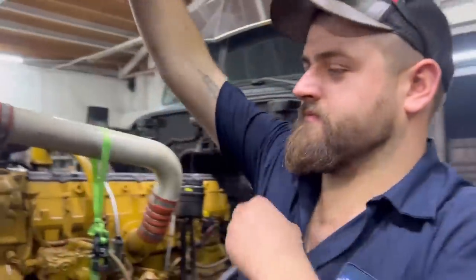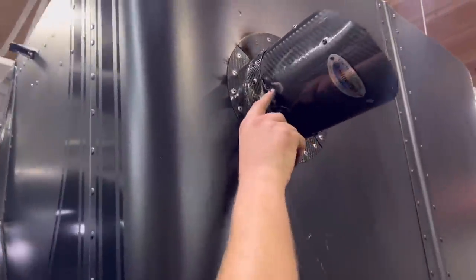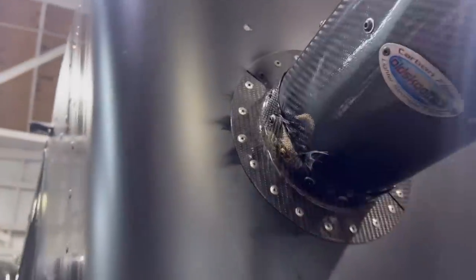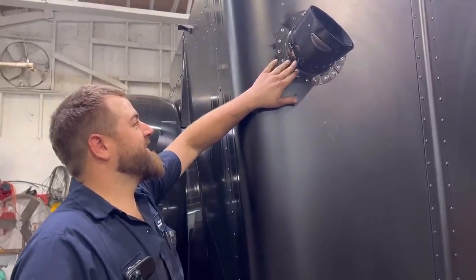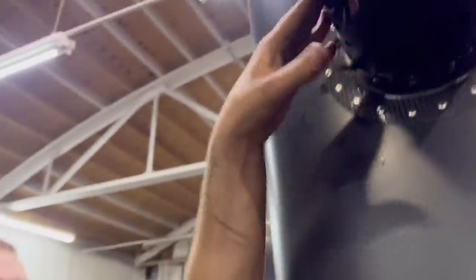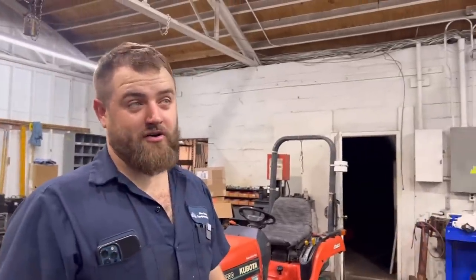Ryan is about to have to get fired - you gotta be on time, dude! Whenever you mounted this Ryan, I told you - I got you on video! It got in between, so whenever the engine torqued the whole engine laid over and it blew. We're gonna have to get this fixed. But it looks cool - gives it character. We just need to extend our pipe up a little bit. We've lost all the EGTs, literally all of them.